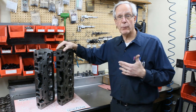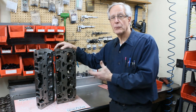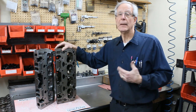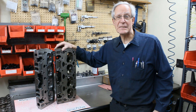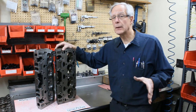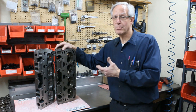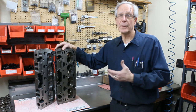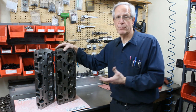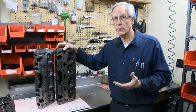However, when you do undercover porting or some other type of porting to these, if it's done correctly by somebody who knows this particular cylinder head, they flow very well — 240, 245. It's a lighter weight head and the intake port winds up being about 180 cc's. It's a very formidable head for a circle track application. I stress it needs to be done by somebody who knows what they're doing — it's a pretty complicated cylinder head. We've literally done hundreds of these over the years. So if you have these Bowtie heads laying around, they can be very formidable in a circle track application.